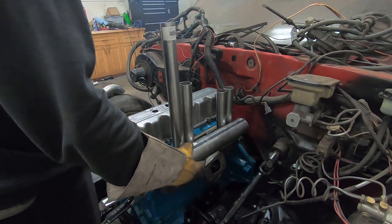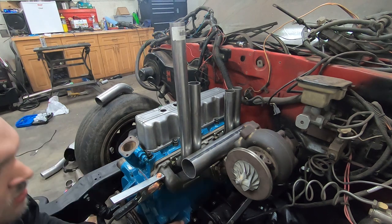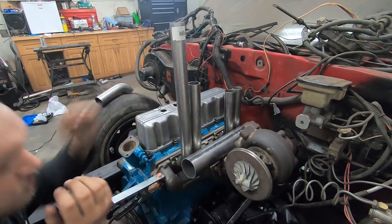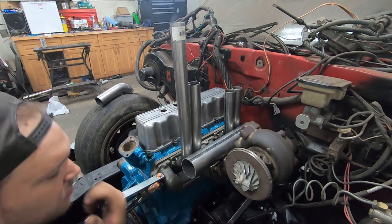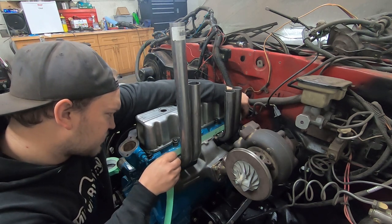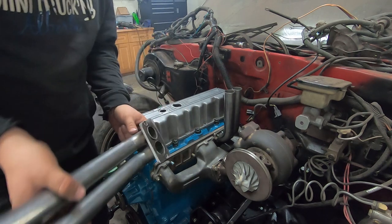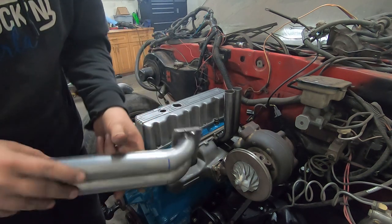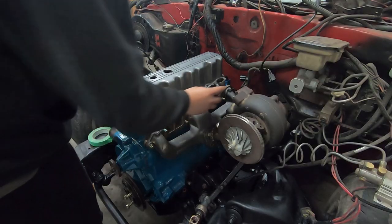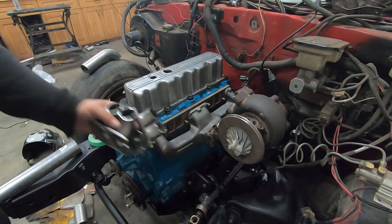This is going to look so dumb. Now where do I want this to sit? The lower the better, because I still have to build a box off of this for the TBI to sit on top of. I won't have room for all my sensors. I'll go just before that curve. Okay, that's a good sign — oh my goodness, that is awful. All right, I'll cut it and get that nice and low. That'll give me space to mount that. I need to mark these before I forget, and these need some cleaning up.